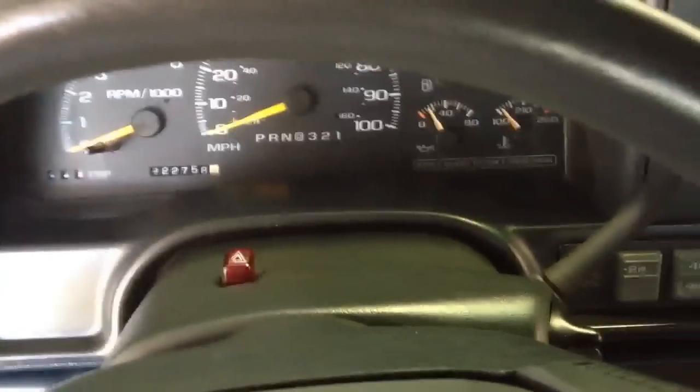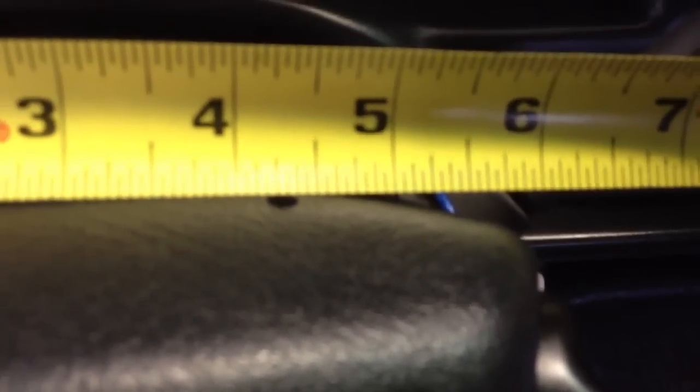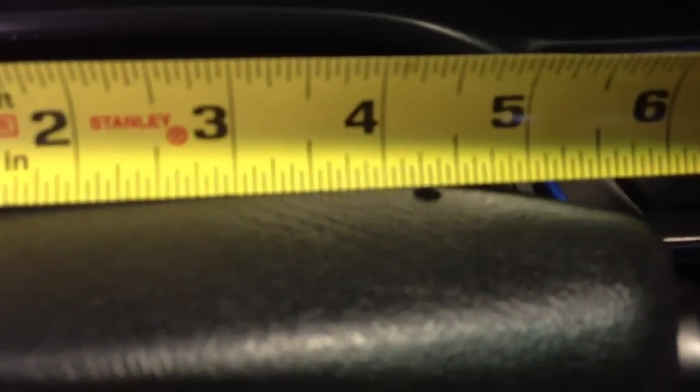Get your tape measure and roll it out — I'm going to pull mine out about 10 inches, which is overkill. Put it against your hazard flasher. Turn yours on and you'll see it start to blink right here. Run it parallel with the face of this. It just has to be parallel with this. Measure out from that, parallel with that, and all you have to do is drill a hole at 4 and a quarter inches out, parallel with the face of this from that.